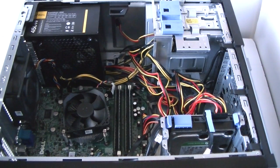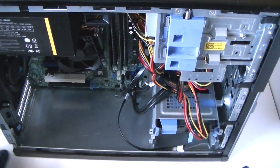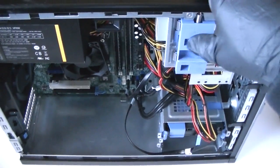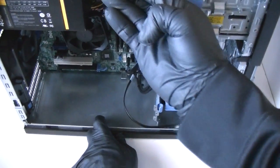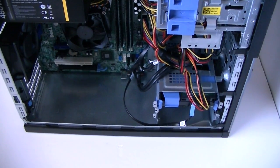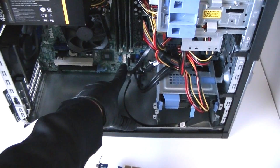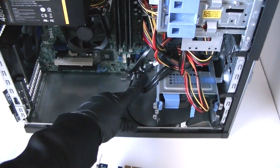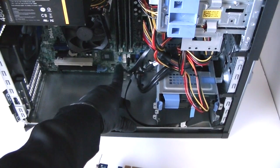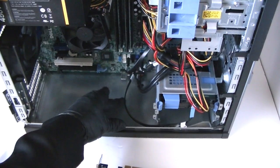Now I'm going to install the video card. I'm going to move the computer so you guys can see it. Let me measure what kind of video card I can install here. I would say about 7 to 7½ inches for the video card. Because if you go over 8 inches, you're going to be blocking the SATA ports here, and the cables would have to be L-shaped SATA cables — not the flat ones. If the video card is around 7 inches, it will work perfectly fine.